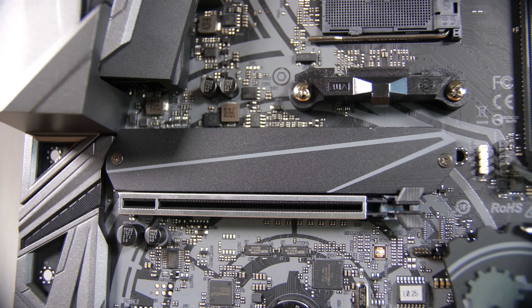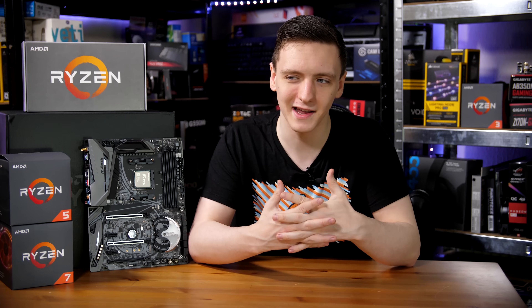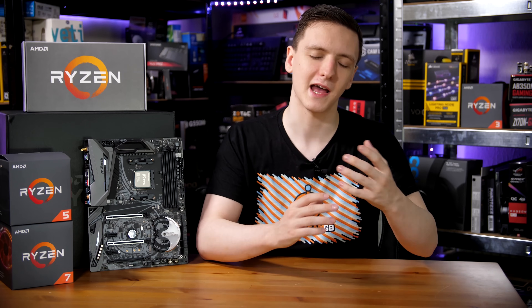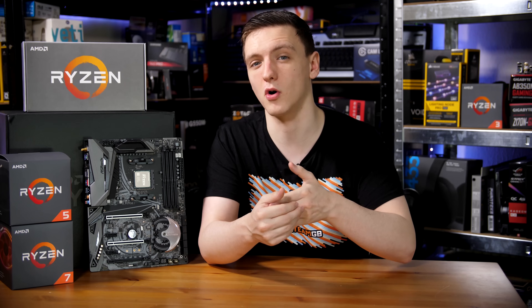Just below the CPU socket, you have a rather large M.2 heatsink. I say rather large because this actually covers the central screw hole that you need to install this motherboard, and it makes it pretty annoying to install. You can almost not get a screw past it unless you have the motherboard slightly off and put the screw in first, or if you just remove that. I'd really like to have seen ASRock think about these things, as that's a very basic usability issue — you physically can't install the motherboard without removing part of it first. It would be nice to see that revised, even just cut down slightly on the backside so that the screws can always fit in.